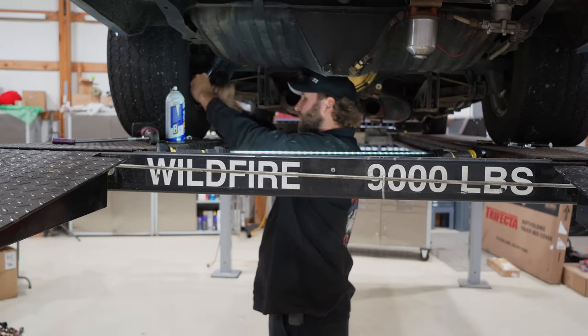So I think the issue here, a chunk just fell out, but he's got lock washers on here without a washer underneath of it. So when you tighten these nuts down, it's just splitting that open like that and cracking it. Then these are lined up precisely, whatever brand this is. I don't even know how he got that in there, because that's just, oh, nuts completely missing on that one. Again, I don't know how he got it in there because of that.